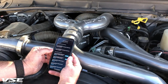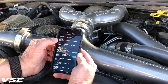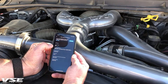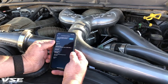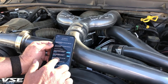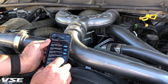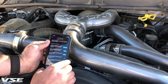It's linked to us, VSE. You can go to the ECU profiles and see that the last installed tune in the truck was a 700 rear wheel horsepower compound turbo application. It has TCM tuning included. You can see the details to install these into the truck — you literally go to the tune you want to install. We have a host of tunes built for it; you go to the cloud, download the tune, and it'll take just a few seconds since it's a 2,000-plus kilobyte file. Then you hit install and it installs the ECM and TCM profile.